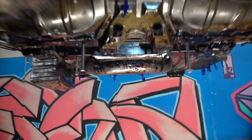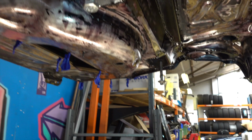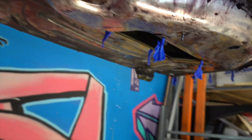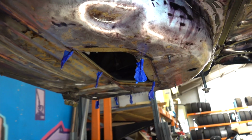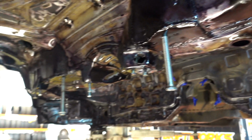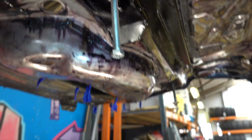Right then, a bit later on that day, you join me back under the car. I've been going around with the torch, just making sure I haven't missed any spots with the RC 900 converter. Spent a bit of time masking off any threads and blocking up any holes that we're going to have to tap before I move on to the next stage, because it just seems like a bad idea to have to clean all these things out.